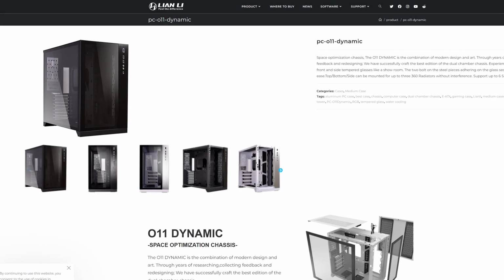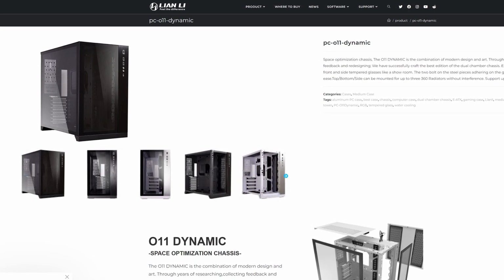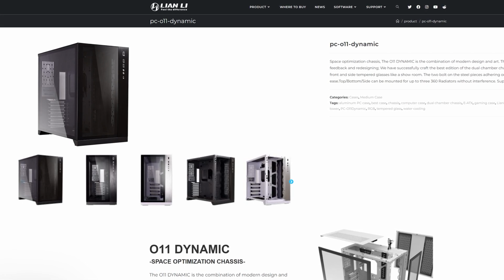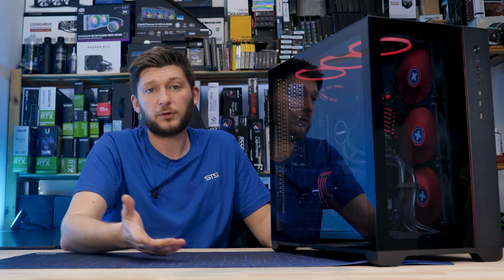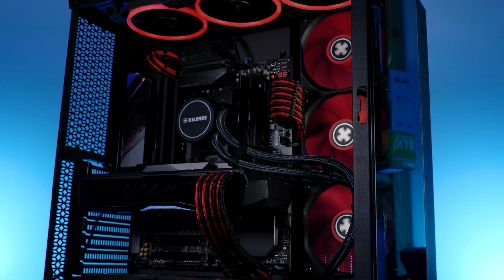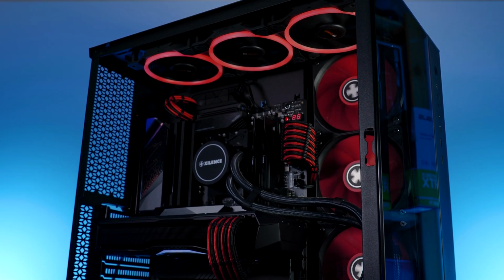But if you haven't noticed it, the Neo Cube follows a similar design approach like the O11 Dynamic. Reposition the PSU behind the motherboard, move everything down, use the forcefully gained space behind the motherboard to add 3 side fans, enjoy cold intake from the bottom and possibly from the side, while the top pushes everything out. Simple, easy and effective enough that this exact design approach has been relevant since it was first introduced. But that's just the ground idea.